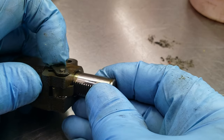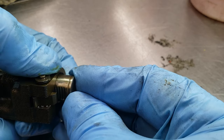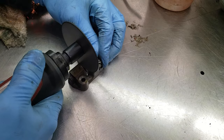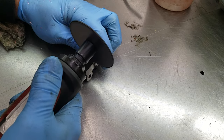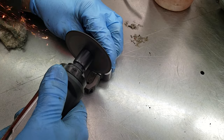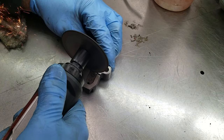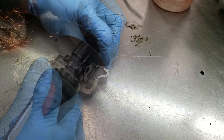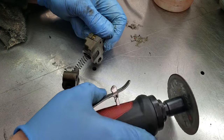The only thing I saw on them was a little bit of varnish on the plunger itself. I wasn't sure if that was what was causing these things to kind of bind up and just not come out and push on the chains like they're supposed to. Once I got them out, I decided to throw them away — why not cut them up and see what's inside? I got the angle grinder out, hanging on to this thing and trying to cut it up without cutting my finger off. I broke my vise so I didn't have anything to hold it in. I'm trying to cut it back without hitting the piston, to see if I can get this thing opened up and find some coked up oil or debris that prevented it from pushing out.